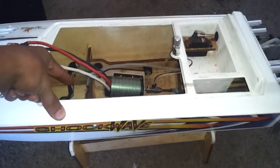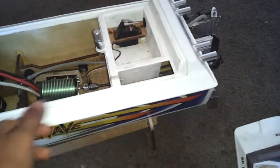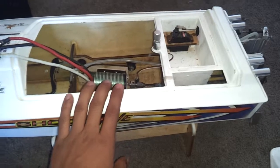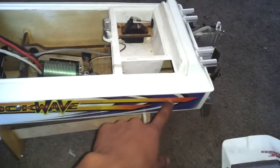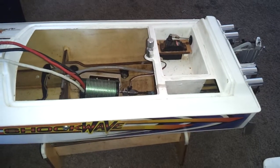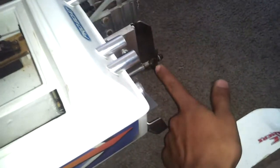I'm putting all my electronics on the front because the Shockwave needs weight forward to go faster. When I had the battery in the back, it would barely move and wasn't getting good water flow to the prop. I ran this boat before with my Mamba Monster on two 5-cell 8500mAh packs — it was amazing. A little heavy and water came in about halfway up the body, but it hauled ass. I have a few short videos on YouTube.